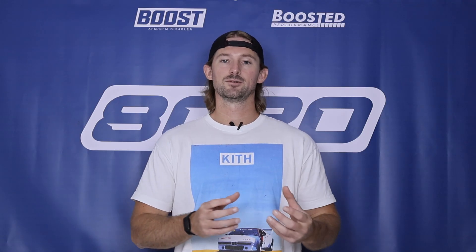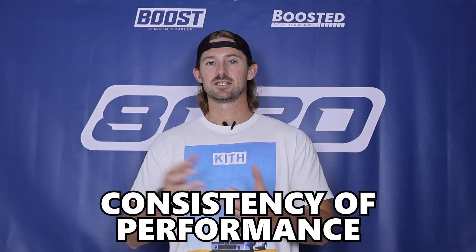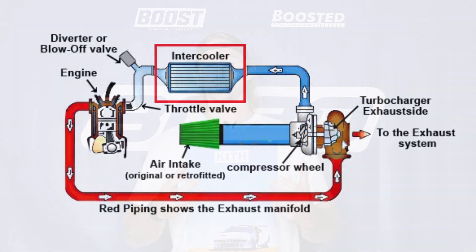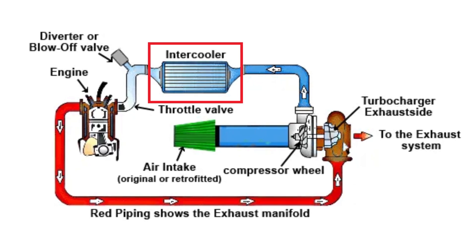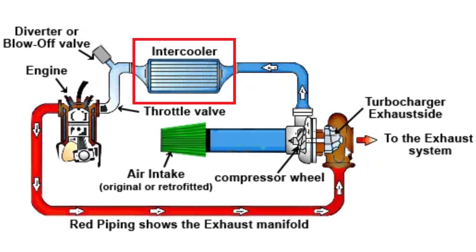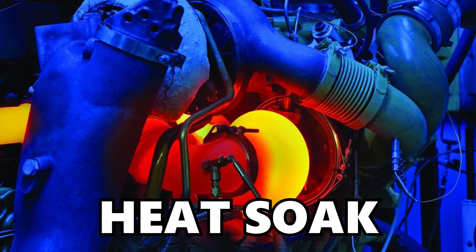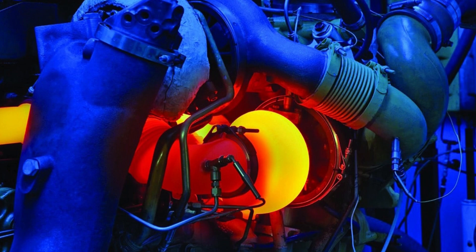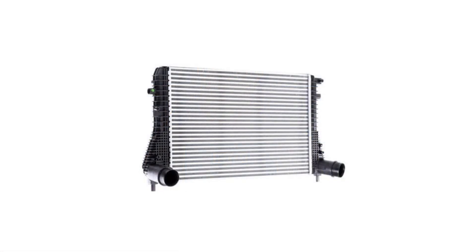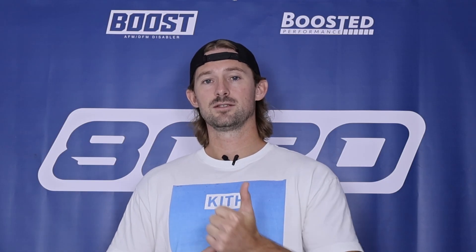Now that we've got higher boost levels, more air coming in, and more air going out, the fourth thing on my list is an upgraded intercooler. An intercooler is really going to be one of the best modifications for consistency of performance and also for reliability. What an intercooler does is make sure we're consistently sending cold air into the engine. A lot of times once we're running higher boost levels and the turbocharger is creating a lot of extra heat, the intercooler gets overwhelmed — that's what's called heat soak — and we end up sending hot air into the engine. The stock intercooler is small from the factory, so by upgrading to a larger one, it'll be able to cool a larger capacity of air, making sure we're consistently sending cold air into the engine, which is good for power gains and good for reliability.